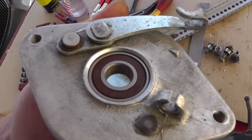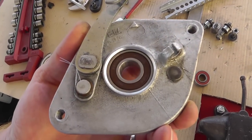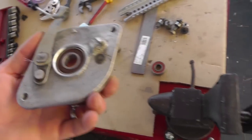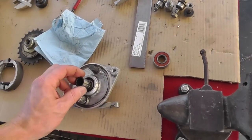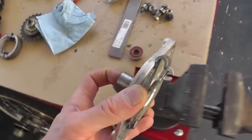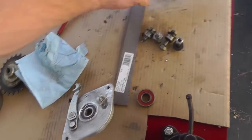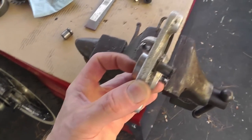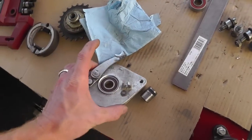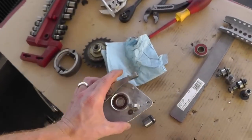So I went and bought a new bearing — a 6202DU, which was the actual OEM part I was supposed to replace it with. This is pressed in there and I was leery about getting it in and out without a regular press, but I was able to use the vise. I set up a jig with the bad bearing, pushed it out using a flat plate, then added a small piece across the edges to push it all the way through. To press the new bearing back in, I set it on top and pressed the two together — bada boom bada bing. Lucky that worked, because if I had bent or damaged this component I would have no more Honda Hobbit to ride.